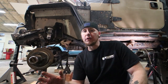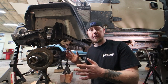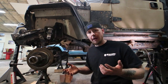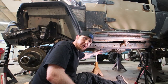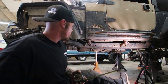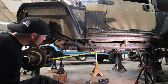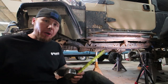The reason I'm going to use a three-link instead of a four-link is that I have my exhaust running down one side of the vehicle — having two upper control arms in the front is too big of an engineering problem. A lot of people have very successful builds with a three-link. I'm going to mount this right about there, really close to where the hole was for my most recent mounting location. Running my tape through the existing lower control arm mount gives me about the angle of the lower control arm at ride height — I can put an angle finder on there to check we're under 10 degrees.